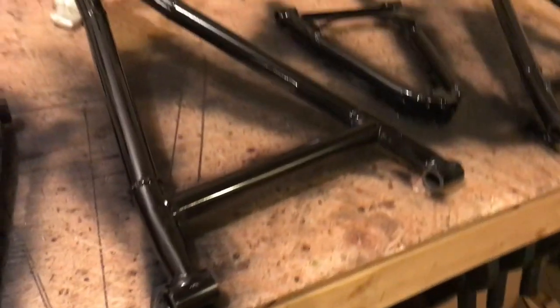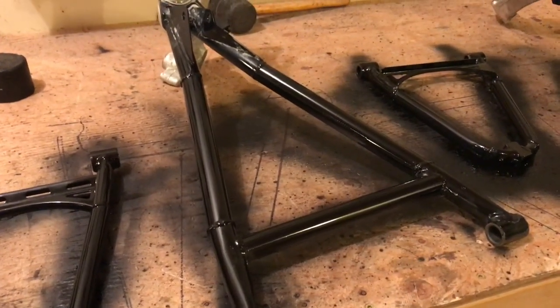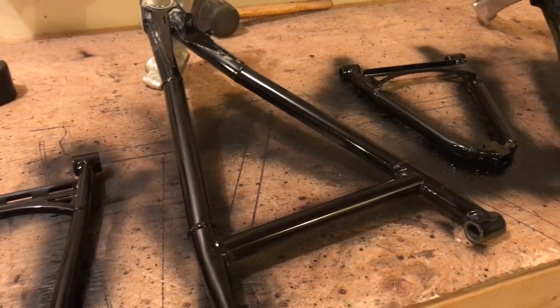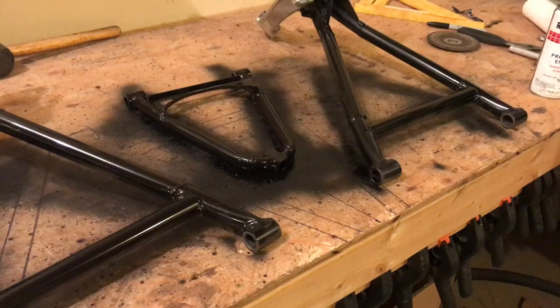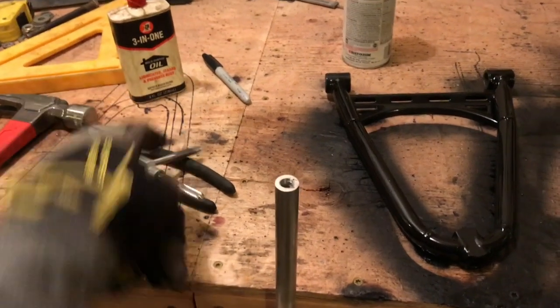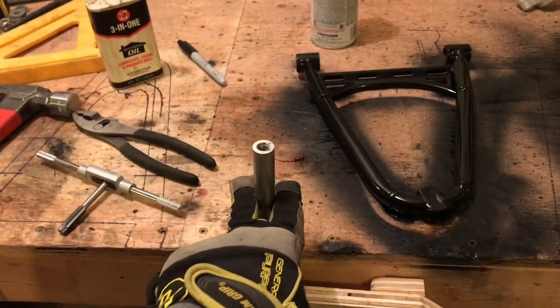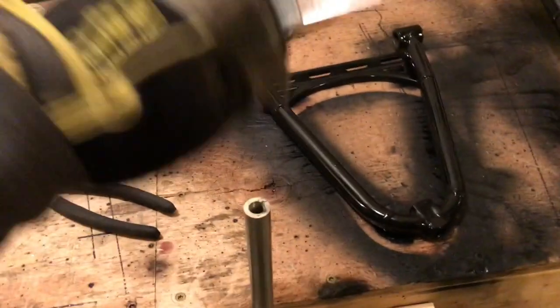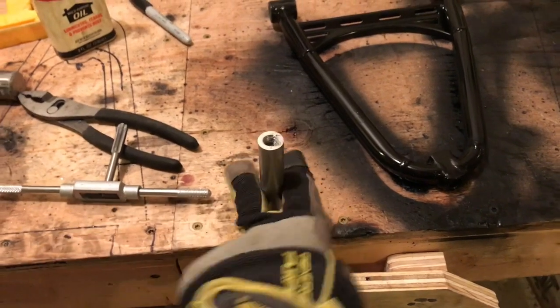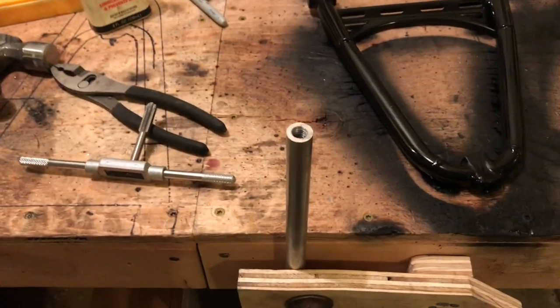Hit them with a grinder and a big buffing wheel to clean them up, do each side, and then the last thing we have to do is figure out the tie rods. I caught a really sweet break with the tie rods — turns out I have the right size tap. What I did is I took the tie rod apart: one end screws standard thread, one end screws reverse thread. I cut two and a half inches off the end with standard thread and I'm just going to re-tap it, then grind some little flats so you can turn it with a wrench to adjust it. It'll essentially look the same as it did before — I just chopped off two and a half inches. Do that on both sides.